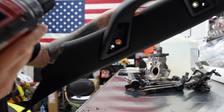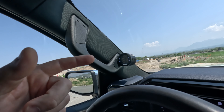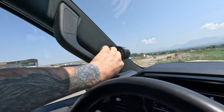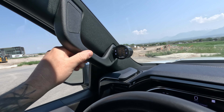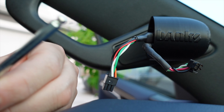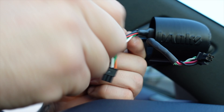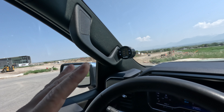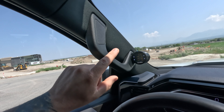The install is really not that difficult. You just got to take off this pillar. The pillar is held on — there are two covers right here. You pop off those covers, then there's a 10-millimeter bolt behind here and a 10-millimeter bolt behind there. You just work the cover out because you need to drill a hole in there. The cool thing is they include the unibit that you need to drill the hole, so you really don't need anything extra. The Allen bolt that comes in to mount this securely — look how firm this is.